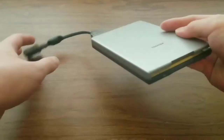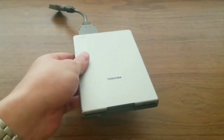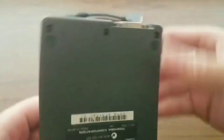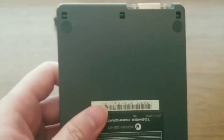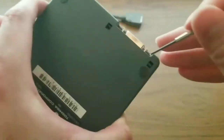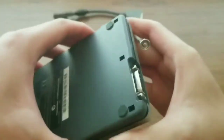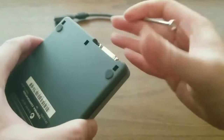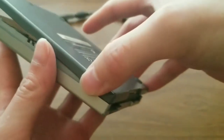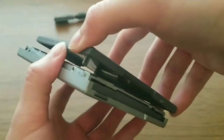Now I am going to open the drive. First I remove any disks that may still be inside and cables that are still attached. Then I bend the three tabs on the bottom of the drive. This opens the back of the drive, but there are two more tabs on the inside of the drive that need to be wiggled around to loosen. A previous attempt years ago broke one of those tabs so there's only one left here.